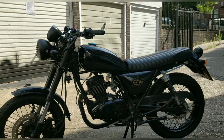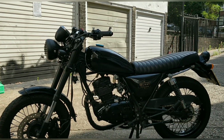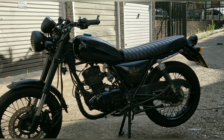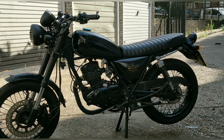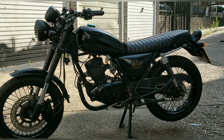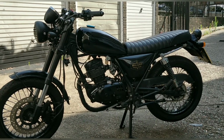I've checked the voltage from the stator and regulator and it's great. It's 14 something on idle. But the batteries that Tayna Batteries have been sending out recently, they've not been good. I know Nat had a bad one or two. I think they've been on the shelf over COVID, and these self-fill lead acid batteries, they're not great anyway, but when they've sat on the shelf for 2 years and then been sent out, it's not good.